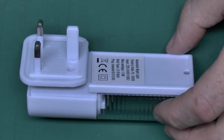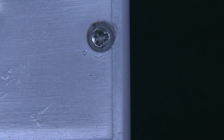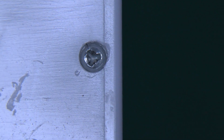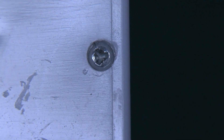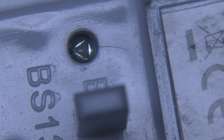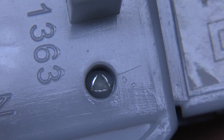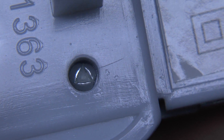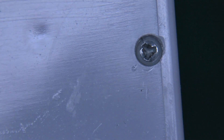I'll just put the other end on there to have a close-up of these screws, because before even opening the device we've got a problem. This is the screw at the top of the case — it's some kind of tri-wing thing. It's extremely small and it also looks rather mashed and destroyed. And if we look at the bottom of the device, which has two fixings, it's another kind of strange triangular affair, and then the other screw in there is the same. So despite this only costing 99 pence, they've gone to the bother of using things which most people won't be able to open — and also used two totally different types of fastener, which seems totally unnecessary, particularly given that they're trying to keep the cost of this thing to an absolute minimum.